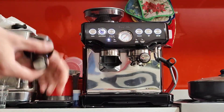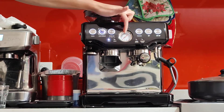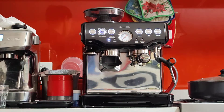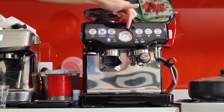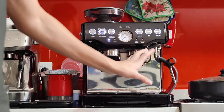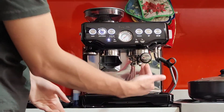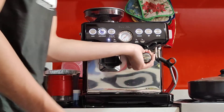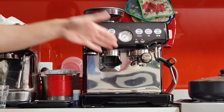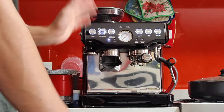The pressure gauge is there to guide you to get the best coffee. For the best coffee, I try to aim for around 12 o'clock, maybe 1 o'clock — so in the 11 o'clock to 1 o'clock range. That's about 8 bars of pressure. You don't need to know the numbers, just know that around 12 o'clock is what you want to get. Also you need to pay attention to the flow of the coffee. As you saw, I put in the coffee and it stopped at 6 o'clock — I can actually push it to 5 o'clock, even more to the right-hand side. I don't want to force it though. With the amount of coffee I have, it can only go to 6 o'clock, so don't force it. It's not good for the coffee or the machine.